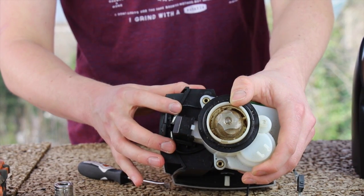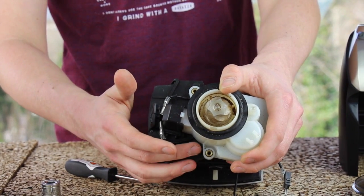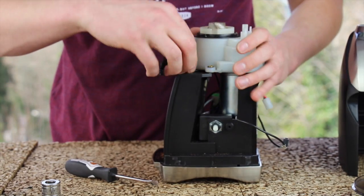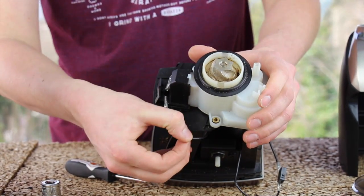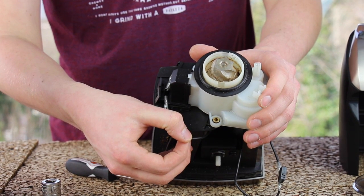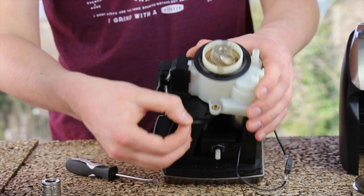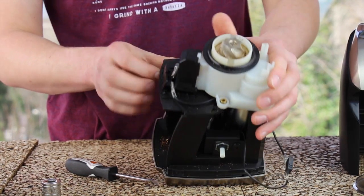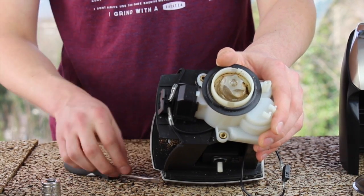Check to make sure that the two wires from the front switch are routed to the inside of the motor mounts. They will route easily to the outside of the motor mounts, like so. However, when you go to install your case, it will get caught on this wire and you will have to take it apart to resolve this issue. So just take a second now to ensure both wires are run to the inside of the screw mounts.